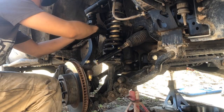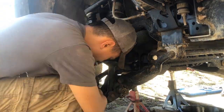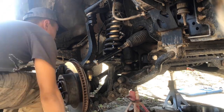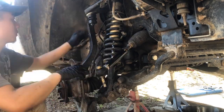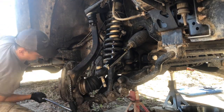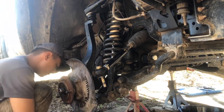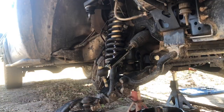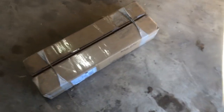This is my preferred method to access the CV axle — it's a couple of extra steps compared to other videos on YouTube, but the benefit of taking off the upper control arm bolts and the tie rod end is that I can remove the whole wheel bearing and knuckle assembly. That way I don't have to lift them because they are heavy, and I get more room to work. With my aftermarket upper control arm and tie rod end, they come off really easily.